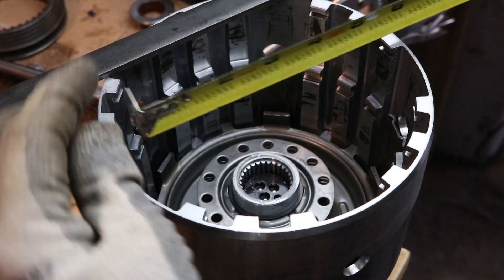The next step is going to be to drill a hole through here and insert the rod. I got this measured and center punched. The next step — I ground all this stuff down. This was galvanized. You don't want to be burning that when you're welding.